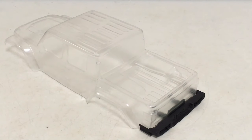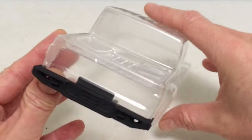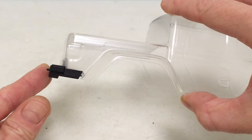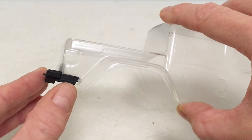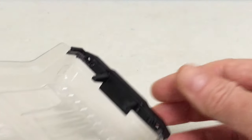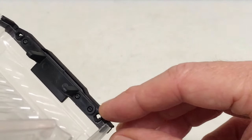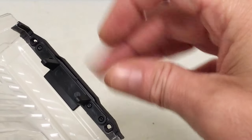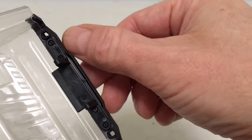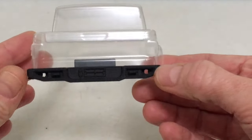Rear bumper mock-up complete, and wow, this thing looks even better than I thought it would. Really liking that wraparound. So for the body trim, I did have to take a little off of the sides for this wraparound, and then as far as the light pods, rather than holes, they ended up being more of a U-shape because they were so close to the bottom edge, but it makes this bumper easy to just drop those in and mount it. And then along the bottom, you can see I trimmed some of that Lexan to follow the bumper profile, just to not have any of it hanging down below this bottom edge.